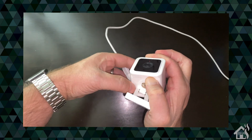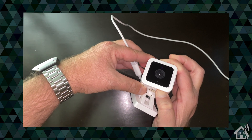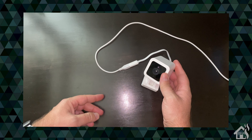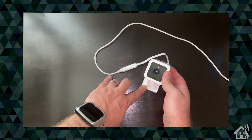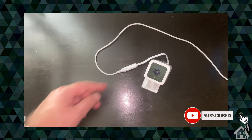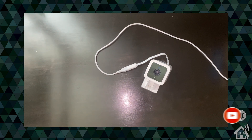Once you do that, when it comes up, you'll see the light change to a purple color — essentially the red and blue lights going at the same time. Then you can stop holding the button and just wait. It'll probably take two or three minutes to do the update. When it's finished, it'll come back online with the blue light again as if it's already connected to your app. As you can see now, it's turned blue, so we're ready to move on to the next step and get it added into Home Assistant.